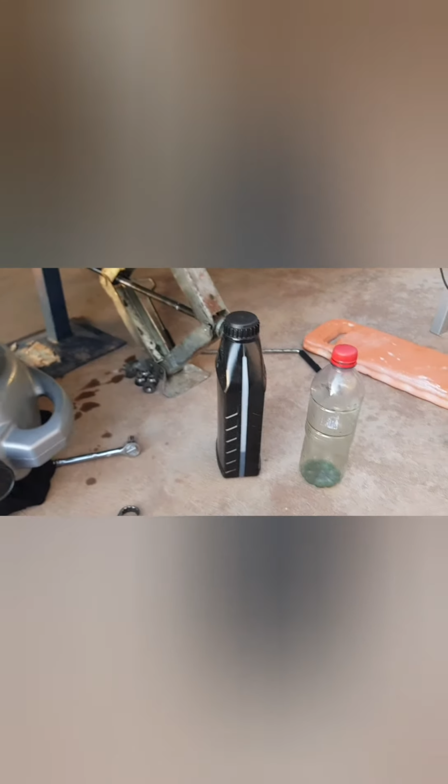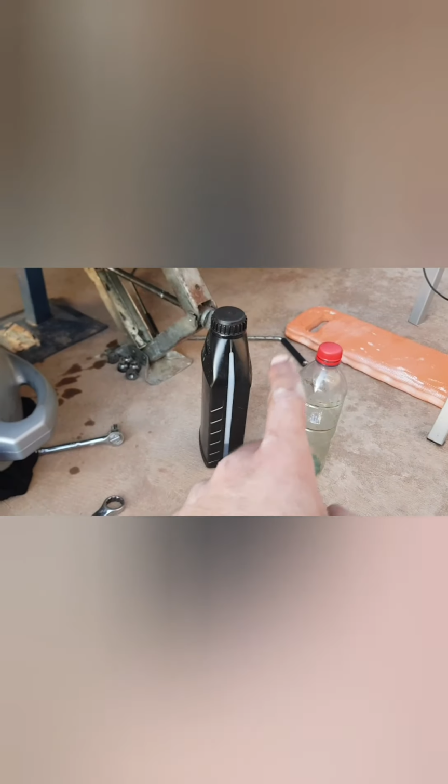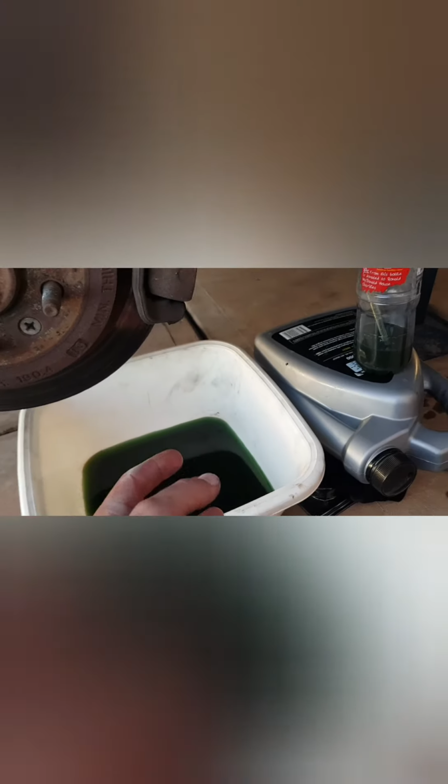But otherwise, guys, what I'm finding here is that I'm about to finish my 1 litre bottle of brake fluid. Whether in this case the fluid was really dirty and needed some good flushing, we're still finding, with this 3rd stage that I'm starting, that it is still dirty. Now, it definitely isn't as dirty as it was initially, because when I was tipping out the 1st and the 2nd bottles, the 1st bottle, the fluid as I was splashing off the side piece here was very dirty.